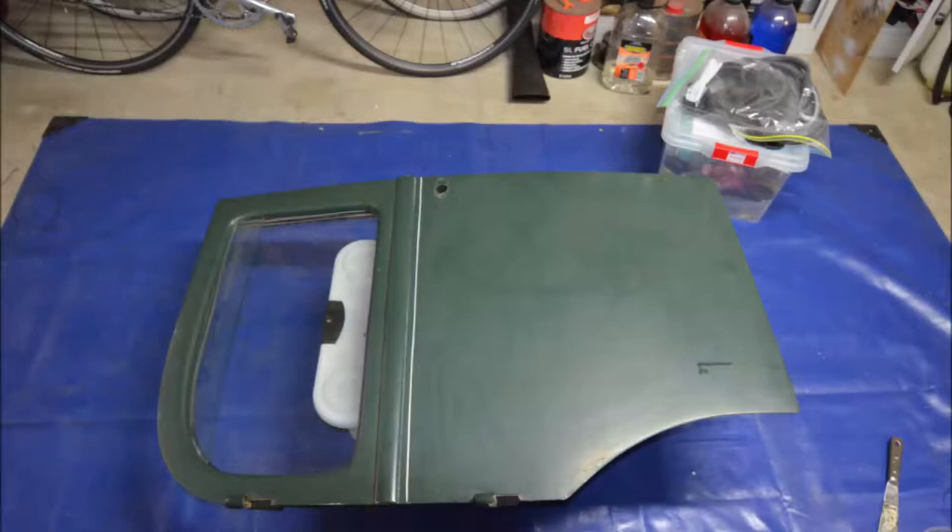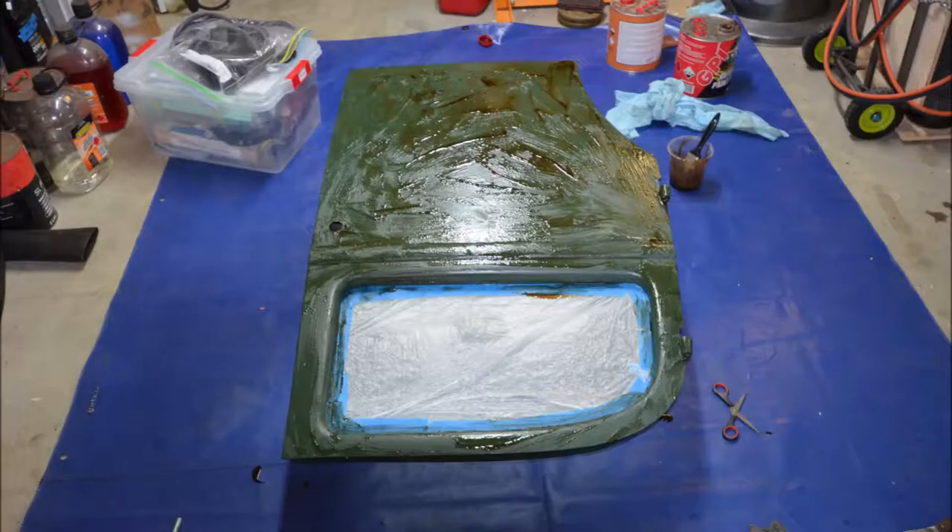Now for the doors. I just took them off one door at a time. They weren't too hard to get off — there are just a couple of pins to remove on the hinges and then the doors can just be lifted off. I've laid the paint stripper on pretty thick. I've covered the glass just to try and avoid any of the paint stripping gel getting inside the door where I didn't want to do any paint stripping.